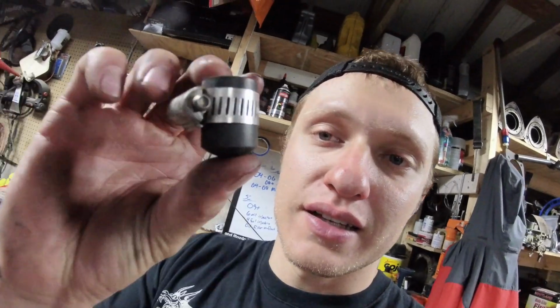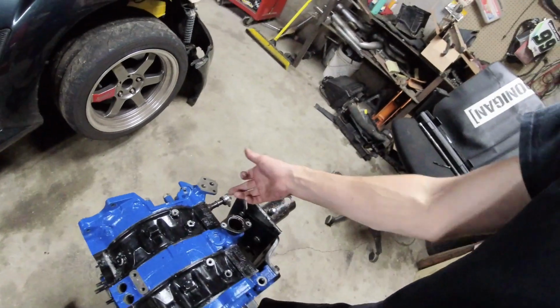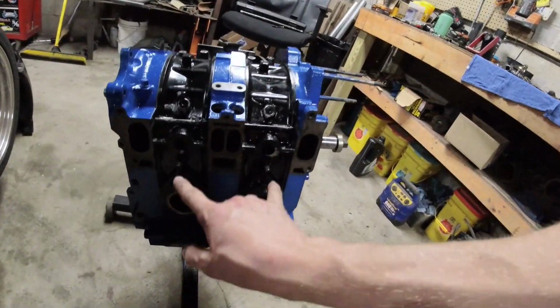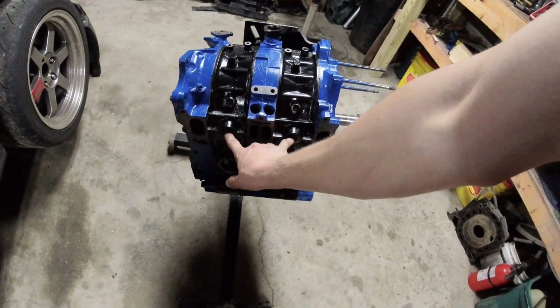The other part of this is make sure you cap off that part right there. There's a coolant temperature sensor down here, and then this port, which has been blocked off on this engine, would also have a coolant passage deal on it. In addition, if you have like an early 12A or something, there's going to be a hole in your housings here. Same with some of the FC13Bs. The T2 models recirculate coolant through the intake manifold then to the turbo. So make sure that you have those blocked off as well. Otherwise, obviously, you'll have a huge coolant leak. But what this is basically, it's like doing a head gasket test. Proves to make sure that everything is good.